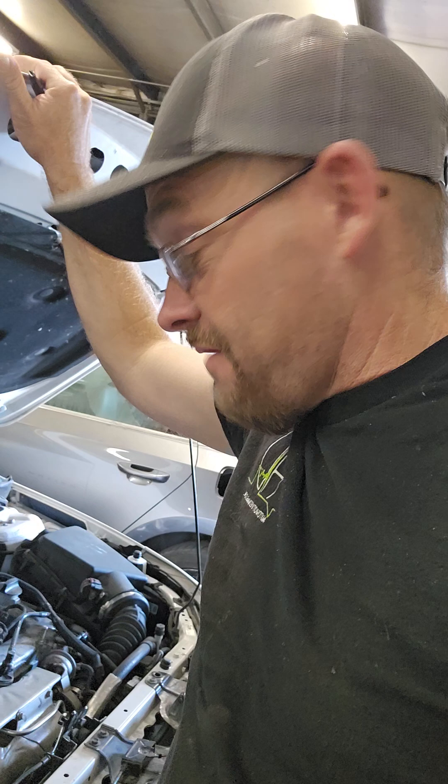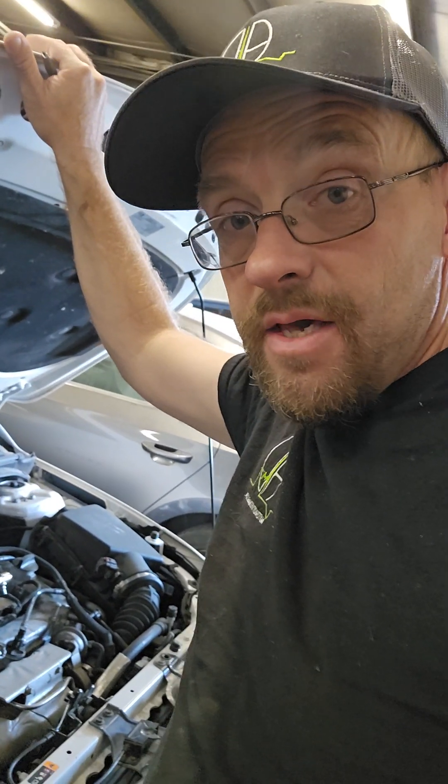At any rate, what I found was — I did it in the in-cylinder — my exhaust cam timing was like 25 degrees slow. I'll post the captures, but that's not right. And then of course I saw the ignition was firing at the wrong time.